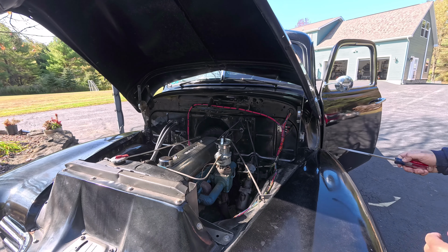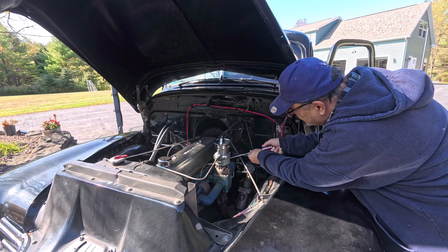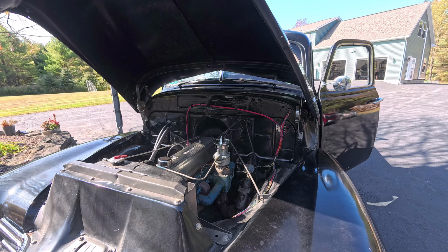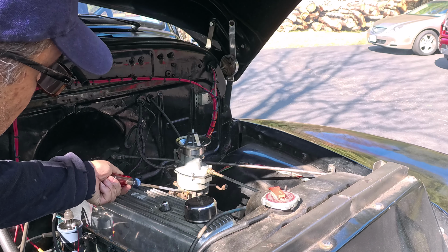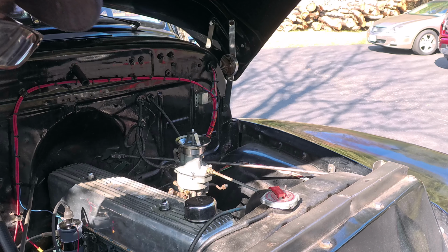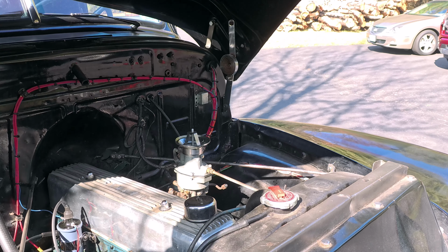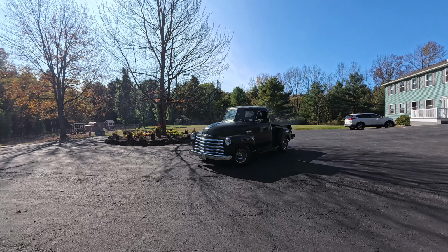So I'm gonna try and set the RPM. 450 to 500. Set the fuel mixture screw. I don't notice a difference there at all. There. I seated it completely and backed it up 1.5. That's where it feels best. It is fun!